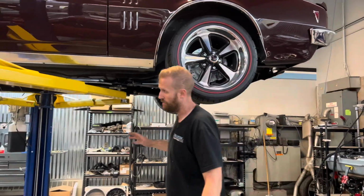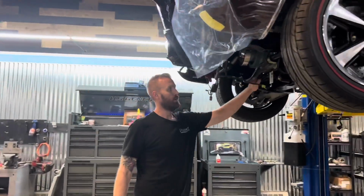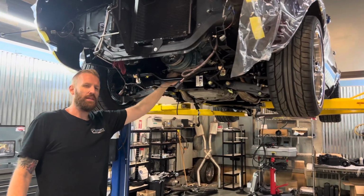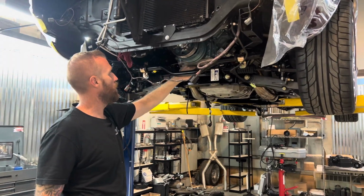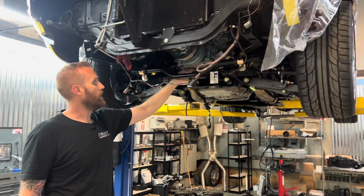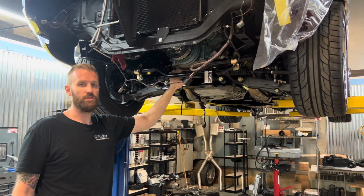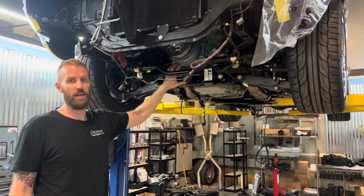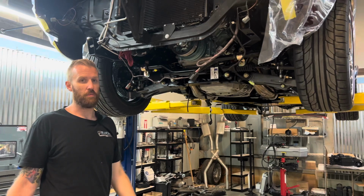Oh, also, we had the Holley 302-1 oil pan, and we found out that we needed the 302-2 oil pan. The 302-1 just kind of hangs a little low, and we ended up contacting the steering rack. So we had to get a different pan. So again, that's the 302-2. That's the pan that the Roadster shop engineered this chassis to work with an LS. So overall, for us, it's a pretty easy job.